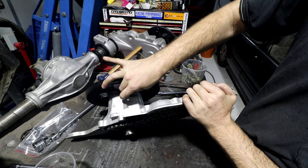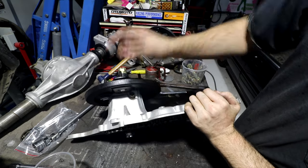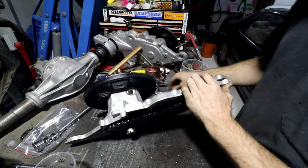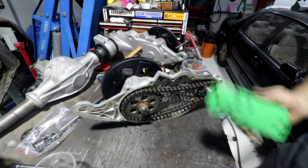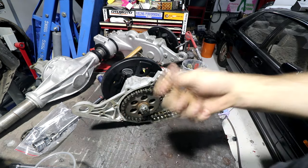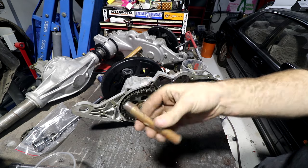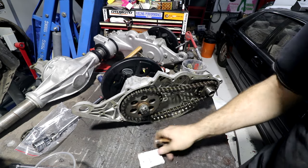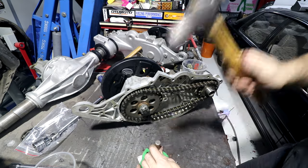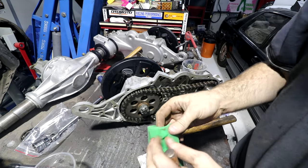The other thing is that little piece is also covered by a cap, but it fell apart when I took it out because it was 60 years old. There's a little foam breather that's supposed to go in there. So what I did for that was get a spare air filter, and we get a wad punch, which is like a very robust hole punch, piece of aluminium, put our punch on there, give it a whack, and there's our little filter piece.